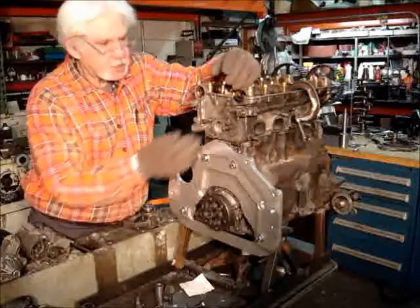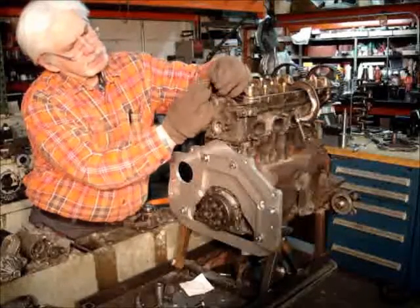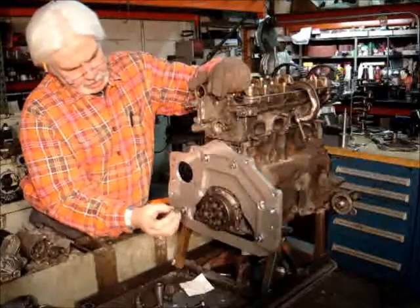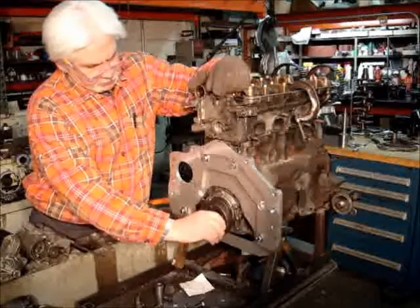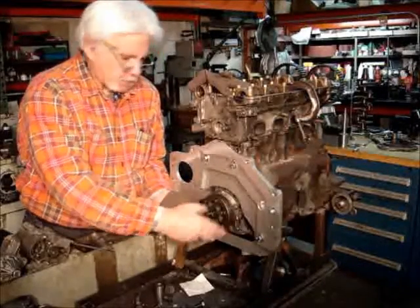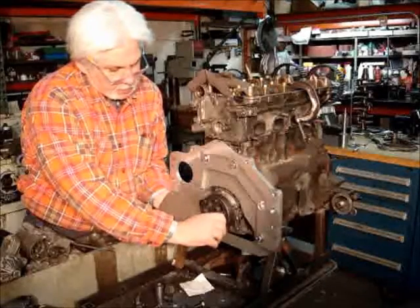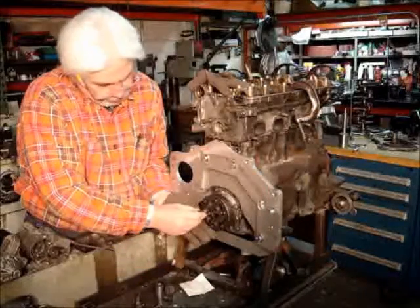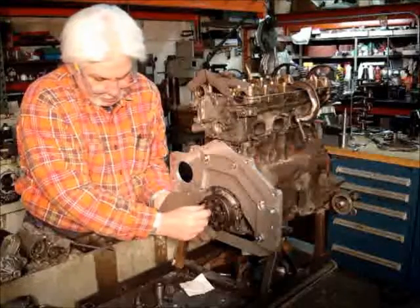Then originally I had used an automatic transmission flywheel bolt because the head was smaller and I could fit it inside these holes of that coupler. Well, I changed that because I wanted the wider head to capture more material to hold the coupler to the crankshaft, and it was a little bit longer, so that allowed more material in the bolt land, so I gained more strength there. I've had guys telling me that they've been ripping up torque converters. They put out so much power. So I wanted to make sure and build this strong enough that, yeah, you can bust a crank, but you ain't gonna bust my coupler.